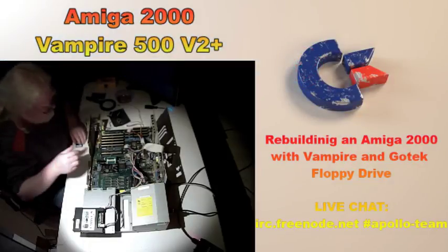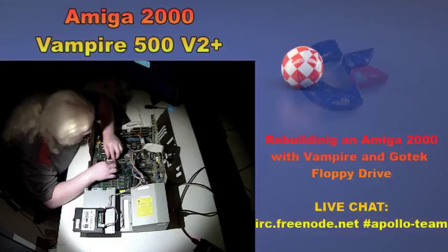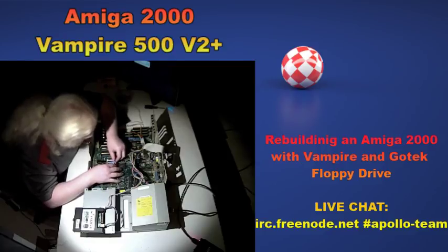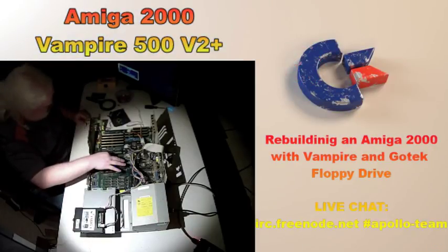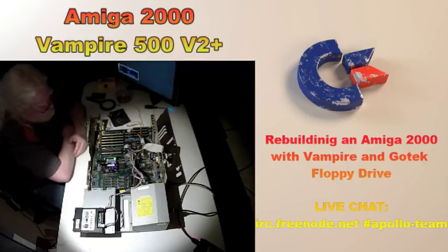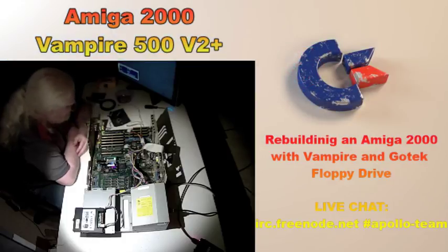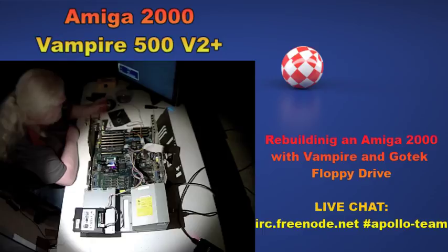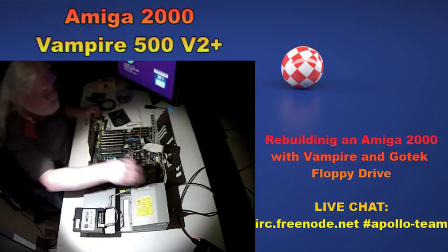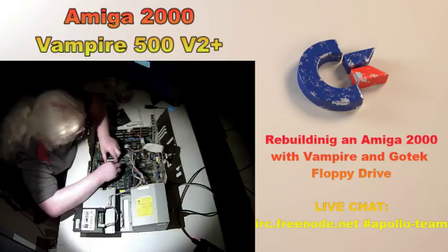Now, once again, I will state that I am doing my best to properly test this. Okay, it tried to read from the drive. It'll likely fail, because I just don't know after my last testing if these compact flash adapters are actually working. And it may be that they're working, they just don't work with this adapter. Although they were working with the adapter I used previously. I did have it booting. It just corrupted the drive whenever I would write to the drive for some reason.